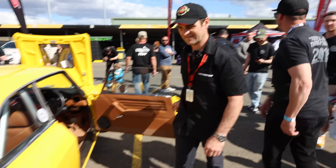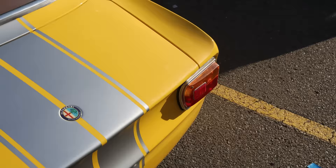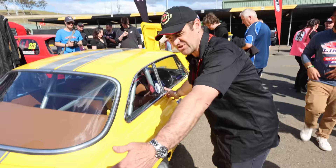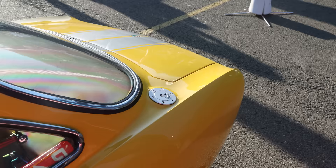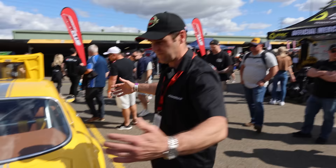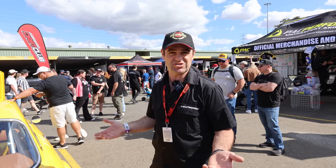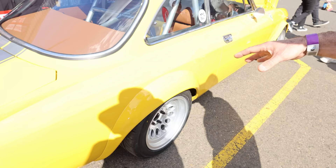Let's talk about the body. I spent a lot of time getting it perfectly straight with all new seals - I did all the bodywork in the shed and painted it, even the stripes are painted. From here back was damaged and rusted once stripped, so I cut everything off from the B-pillar back and remade the whole rear end. I bought replacement panels but they're all separate panels that now have to be perfectly aligned - I had to make a lot of rust repair panels that didn't exist. The overfenders are aftermarket but period-correct, which is why they look different front and rear - that's how they were done back in the day.